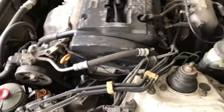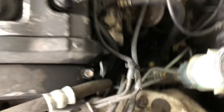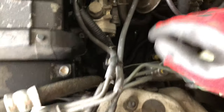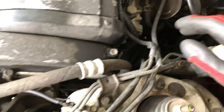Next I need to take out the oil filter. This is usually the hardest thing to do because sometimes it'll be on super tight, but I got these gloves with grips on them so it's gonna make removing the oil filter a lot easier. My oil filter is up here — it's only on the Prelude SH models. Before I unscrew it I want to make sure the oil drain is directly under the oil filter so when oil leaks it'll go straight to the oil pan.